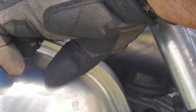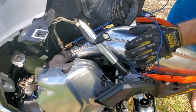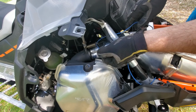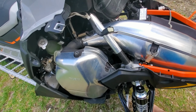I did that for the bottom spring that you can't even see. Can you get the camera down there? That made life 10 times easier by just doing a simple wire grab. Get a fairly strong wire, you don't want it breaking. But I'll show you how it goes on. Are you ready? So, pull. And then pull the wire out. That's it. That should help some guys out there with those exhaust springs that are hard to get at. I wish I had thought about this a long time ago. Anyways.